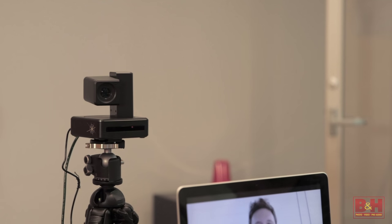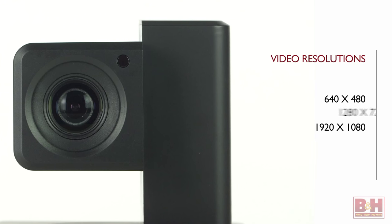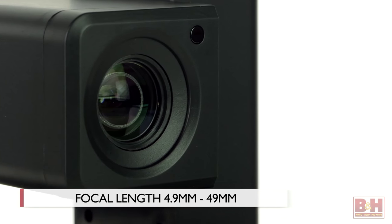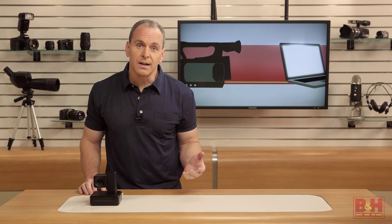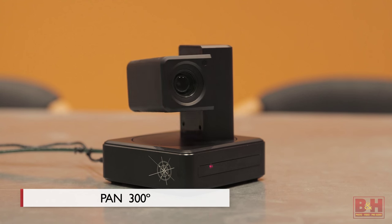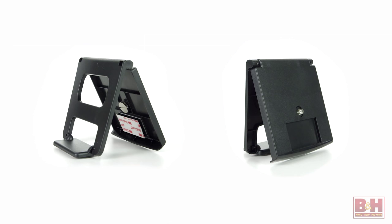The Beacon captures video in several resolutions at 30 frames a second using a 1/2.7-inch image sensor: 640x480, 1280x720, and 1920x1080, which is full high definition. It has a focal length range from 4.9 to 49 millimeters, so it's wide enough to fit a lot into its frame, and as you might guess from its focal range, it offers 10x optical zoom. Optical zoom means the Beacon zooms with its lens rather than digitally, so you don't sacrifice image quality when you zoom in. The Beacon can pan 300 degrees — not a full 360-degree circle, so it can go most of the way around — and it can tilt up and down 180 degrees.